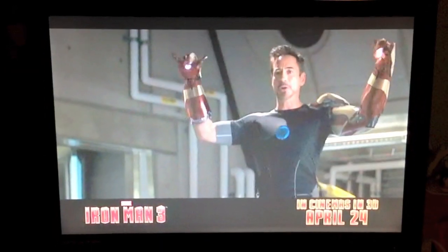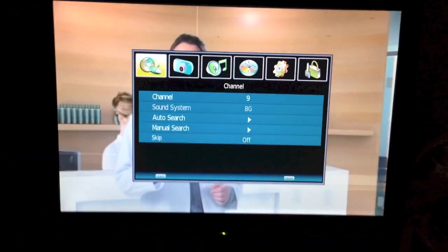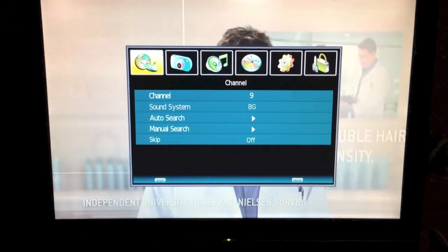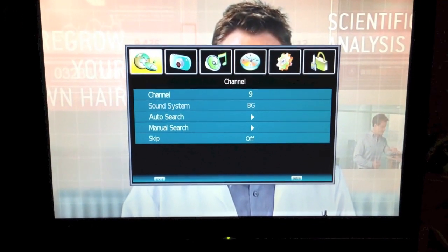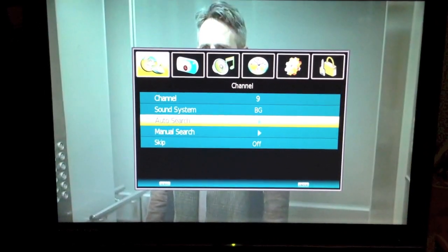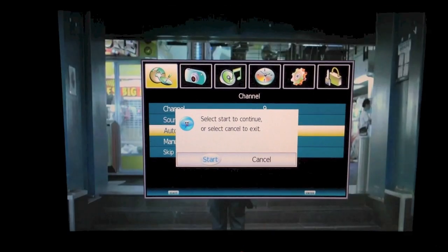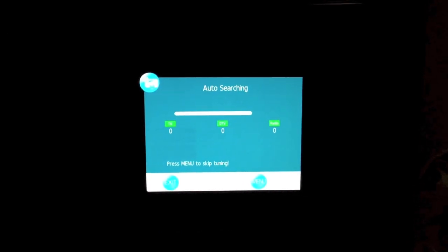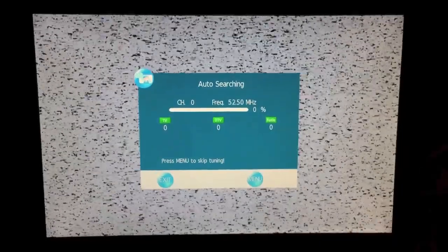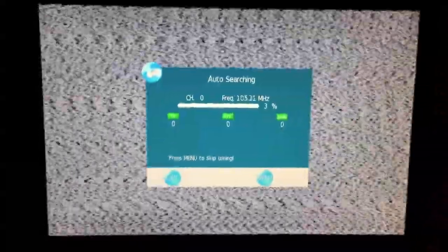So here we are with another TV — this is a Chang Hong Celestial, just a TV and DVD player all in one. So just really quickly, just to show you the slight difference — there's really not too much difference from the LG TV. I've got the remote here again and I'm just going to press the menu button, and it brings up similar menu options to previously. I'm going to scroll down using the arrow buttons on the remote to Auto Search. In this case it's got a right-pointing arrow, so I'm just going to press right and select Start to continue or Cancel to exit. Hitting the middle enter button on the remote, we're going to set up a new auto search, and this will check through and retune the TV. So we'll just skip to the end of the tuning just to show you how this looks on this brand of TV compared to the previous one.